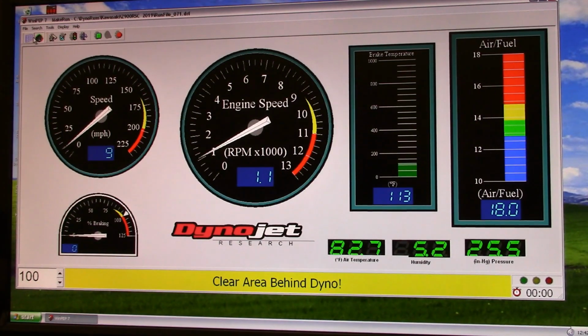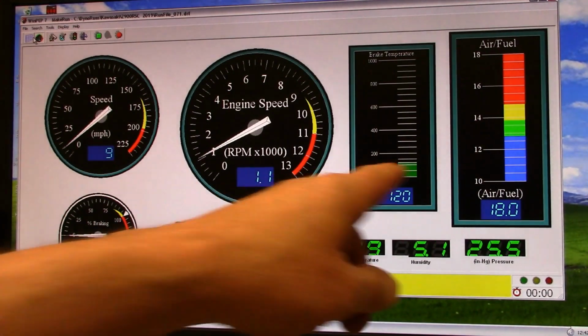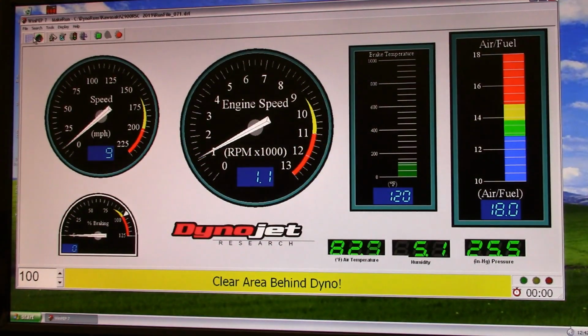So now you can see, let's slide that door open a little, Kurt, some air in here. Now you can see why, when you're putting along in second gear, third gear through town, it's up around 14 and a half or 15 to 1. All right, so when you're easy on it, and when you roll out, if they all go lean, you can't really judge that.